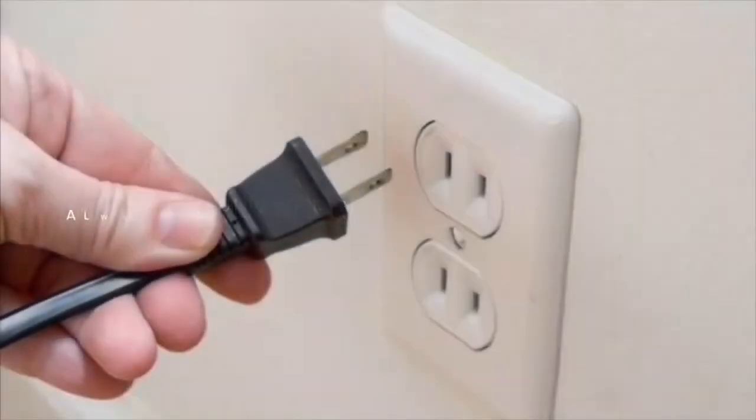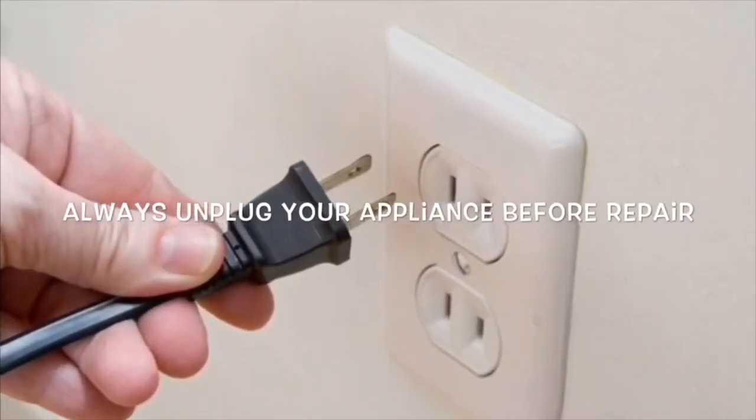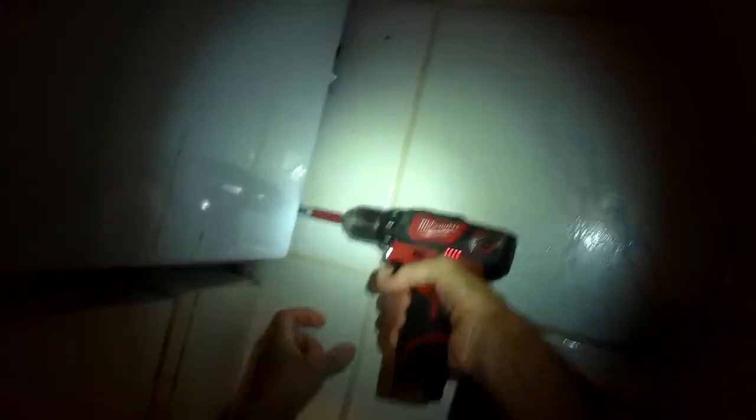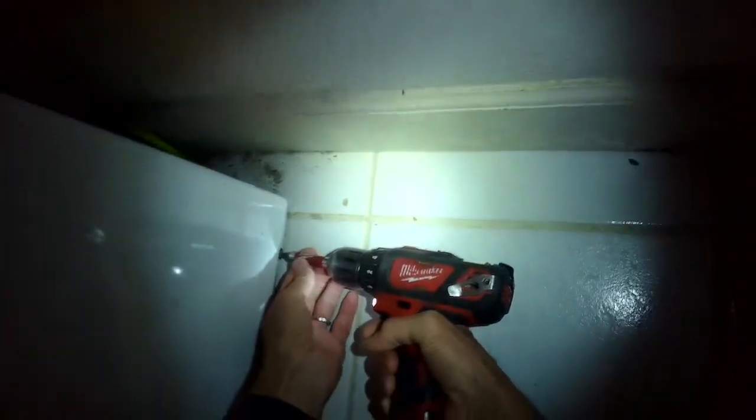Our goal with our videos is to empower you to be able to do the repairs on your own and save a whole lot of money and also get that great feeling of having fixed it by yourself. Today we have a Frigidaire laundry center where the washing machine is not spinning and it's not agitating. You can hear the motor, but it's just not doing anything, and that's due to either a broken belt or a belt that's kind of worn out, just kind of slipping.